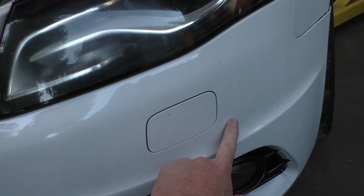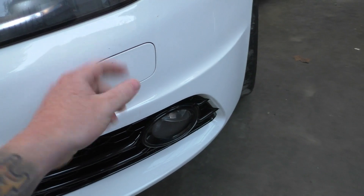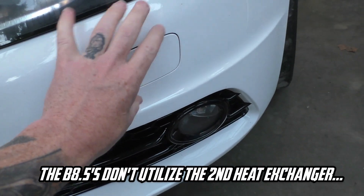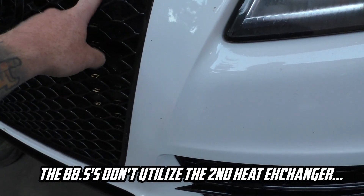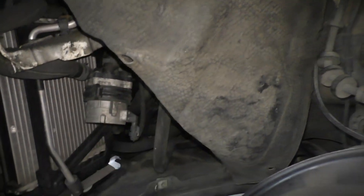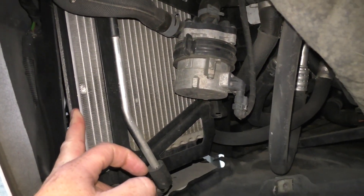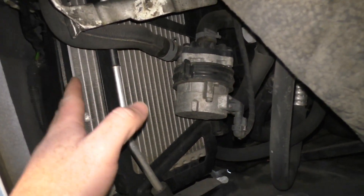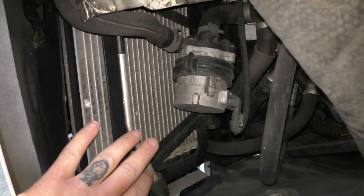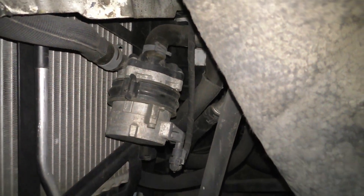Time to get to the install. The pump is located back here. On these B8 models, we're actually going to have a secondary heat exchanger down here. We're going to be removing that and taking it out of the system, seeing as the B8s do not utilize that second heat exchanger, and we're going to be solely relying on this S6 Merc Racing heat exchanger that I'm already using. Kyle's pulled back the fender liner and there is the pump right there. Here is the additional cooler I spoke about.